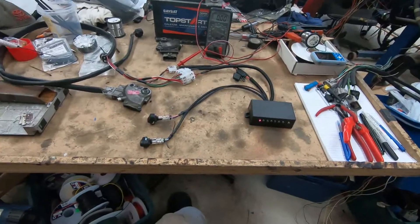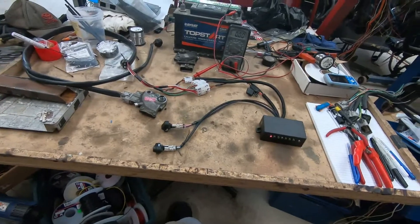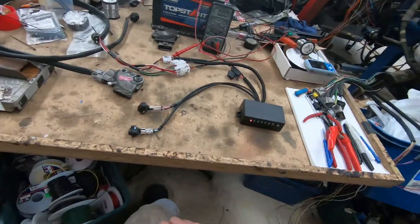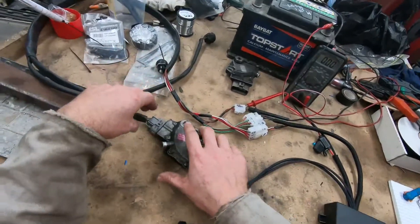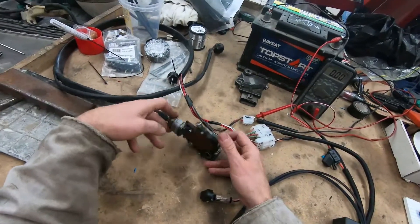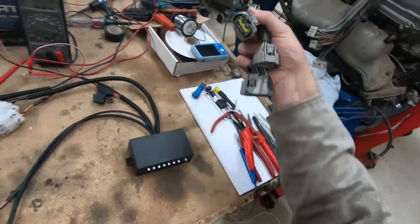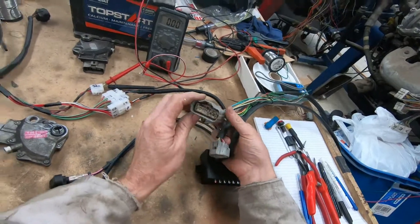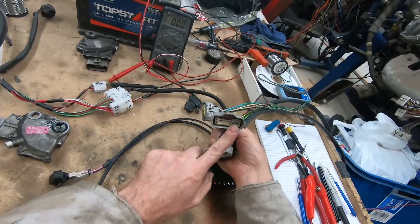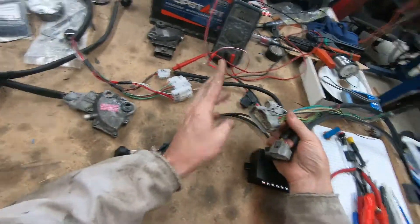If you get it wrong with the lock-up you will break your gearbox, so guys do need to know what they're doing. With the shift selector switches there are a couple of options: there's the small one — this is the small Surf one, that's that plug there — and then there's the later bigger one, which is that one there. This works on the four-speed, not the five-speed, so those are your two selections.